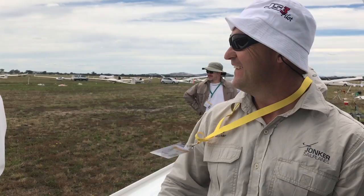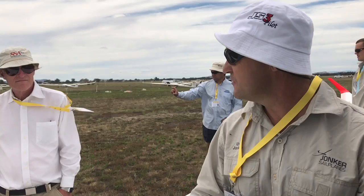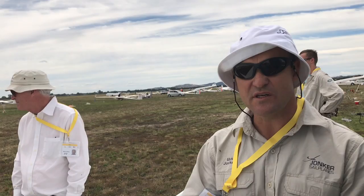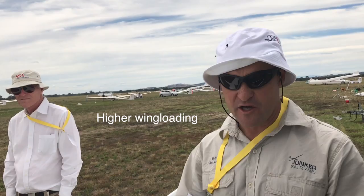Retractable tail gear and cleaning the tail, optional retractable. I think for rough conditions you should just use a normal fixed wheel. But there's nothing sticking out in the sides, nothing obstructing the fin, so we have probes in the tail plane, so you lose less laminar flow area. And a slightly higher aspect rudder, so that your forces are lighter and you have bigger laminar flow areas over the tail section. In general, we scored a lot of additional laminar area in the aircraft. The gains are higher wing loading and more laminar area.